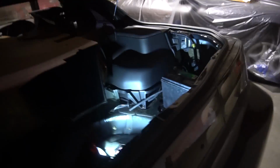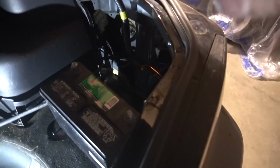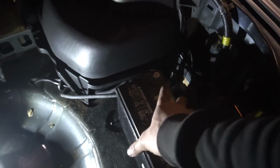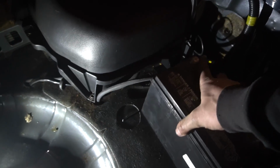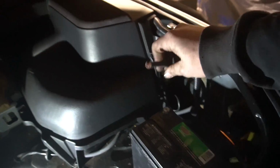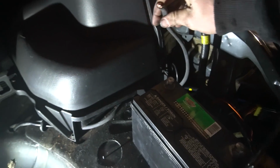All right, so my battery's gonna be basically in this location. I'll be using the same battery as this. I always use CRV batteries because they're just kind of like the best fitting battery overall with a good cold cranking amp. As you can see, it's pretty slim. So I'm gonna say it's gonna be over here somewhere. There's a lot of give in the wire, so I cut it on the longer side just so when I do add my fuse block in here, I'll have enough wire. So now that we have our power wire, we have to do our ground wire.